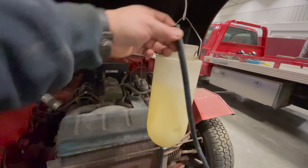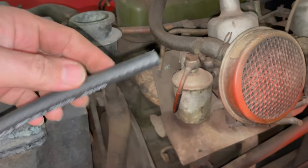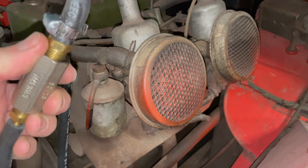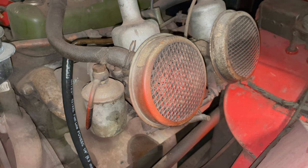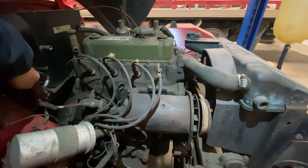To start the engine I'm going to use my little drip tank of fuel - it has a valve on it so I can shut it off. I have the two ends cut off now. I'm going to hook up my fuel IV drip to this end so we can put fuel in the carburetors. Let's turn on the fuel and see if the float bowls fill up. We can see this carb is starting to leak now as the fuel bowl fills up. The gaskets on these carbs will have shrunk over time from drying out without any fuel near them. Let's crank it over and see what happens.